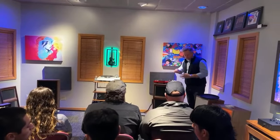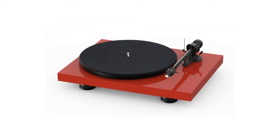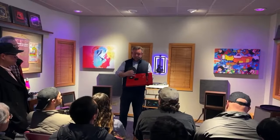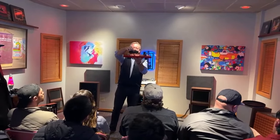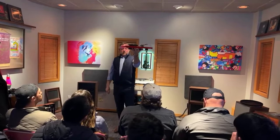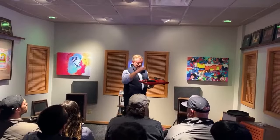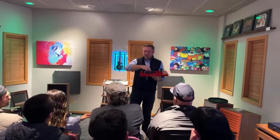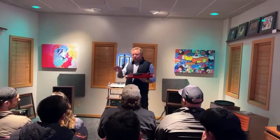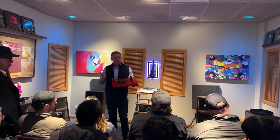I want to show you what's important about that. This is a Debut Carbon Evo — a $600 retail turntable from Project, on best-of lists from anybody who's ever written one about turntables. That bearing well that's passing around is actually what's in this table. Here's the subplatter; there's a bearing surface — that stainless steel part goes through the subplatter. As I pop this into that bearing well — see how long that took to settle in there? That's literally how long it takes for the air to be displaced from that bearing well. Very, very tight tolerances.